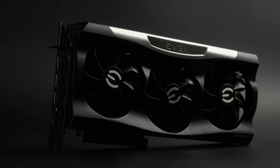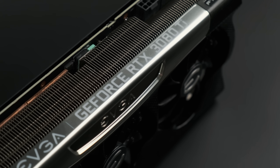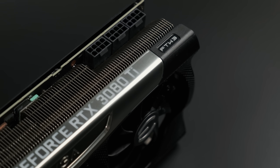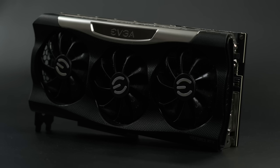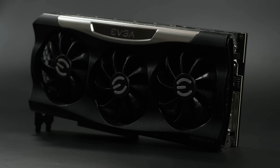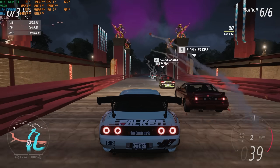When it comes to the GPU, I'm using an NVIDIA RTX 3080 Ti, powered by an EVGA 750W PSU. Both would seem to be a bit overkill — the graphics card only needs about 400W max, but it also needs three 8-pin PCI connectors, which you won't normally find on less than a 500W PSU. The 3080 Ti is still a pretty powerful GPU, so you might think there's a danger that the mobile CPU would act as a bottleneck — and that's definitely true — but if bottlenecks put you off, then buckle up, because that ain't the worst of it.